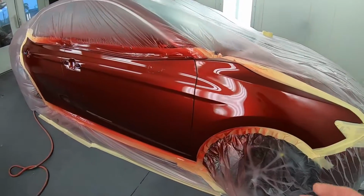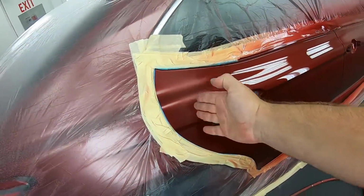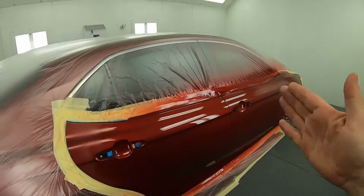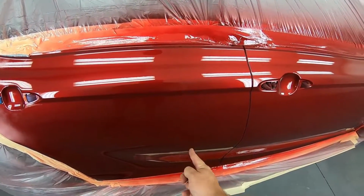So here it is. It's not gonna be 100% glossy. It's not supposed to be. It is only a tinted clear coat. That's all it is. So right here, we wanna make sure we stayed away from the edge, because we want that area to still match, okay? And we had to take it further than the base coat. So the base coat stopped here, tinted clear stops here. We had our damage all the way up into here, into this area. So that's why, you really can lose track real quick, and you gotta stay consistent to your areas and keep them very, very tight. So we'll see if we're gonna do the second coat. If not, we're just gonna jump into clear and we'll go from there.